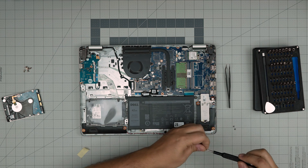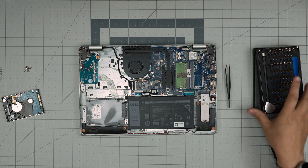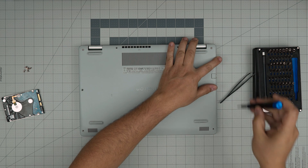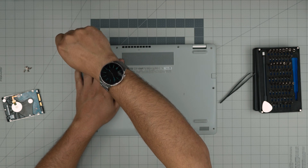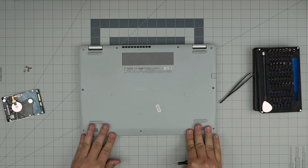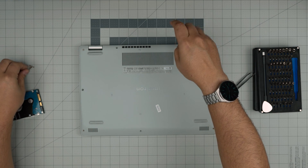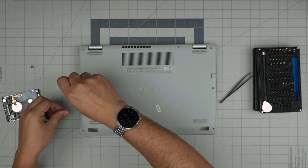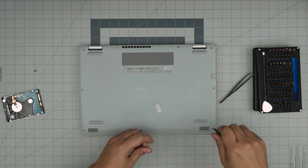That's how you can upgrade and remove the storage for your Dell Inspiron 15 3000 series. To finish up, grab the bottom cover and bring it up straight. Don't push the corners in — keep them slightly over and tighten the corner screws. Let the screw do the job and it will pull the cover to itself. Then push the back side down — you want to hear nice click sounds on the sides and big clicks in the front corners. Once it's all in place, put the bottom screws back in. I hope this helped you with your Dell Inspiron 15 upgrade. If you have any questions or requests, feel free to leave them in the comments. Thanks for watching and I'll see you in my next video.